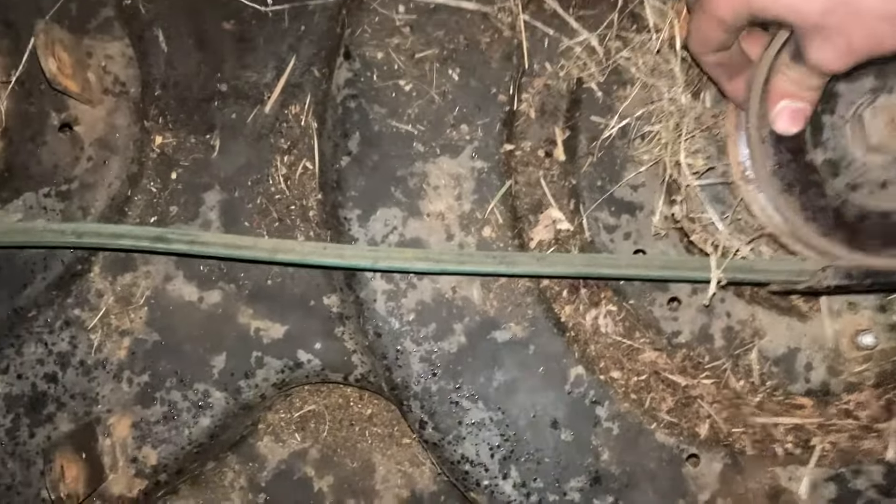The deck is over here. This deck is in beautiful shape for the age of it — hardly any surface rust on it, it's in amazing shape. Now, it's gonna need a bearing right there on that side. This one's good, that one's loose and a little bit noisy. I'll save this for another machine — I'm sure I'll come across an MTD that needs a deck. I also got all the deck mounts off the one I'm selling. Might need them, don't know. I'm gonna save this for now and stick it on a different machine.